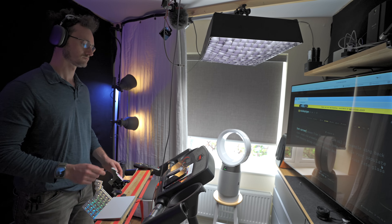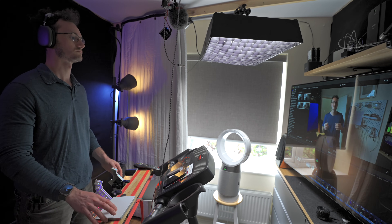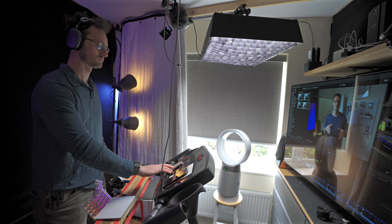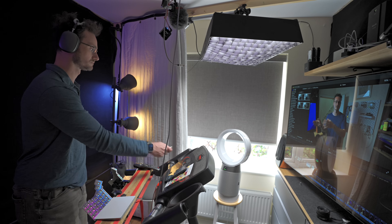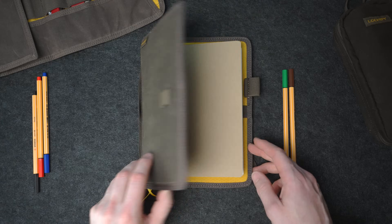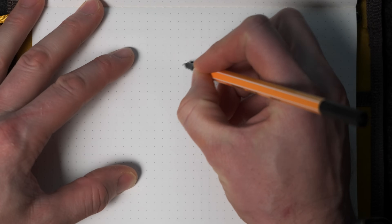This super low level mode was actually one of the main reasons I bought the Dyson fans in the first place — I knew that for most of the year in the office I just needed a gentle airflow. Cheap desk fans don't have this low level mode, and not just because of design choices — they actually can't. The cheap motors they use just can't run at super low levels, whereas the brushless DC motors in the Dyson fan can run at high torque even at low speeds. This benefit is inherent in the technology differences between the two fans.